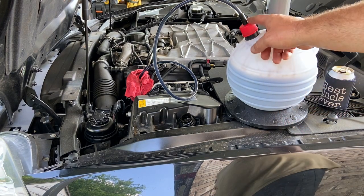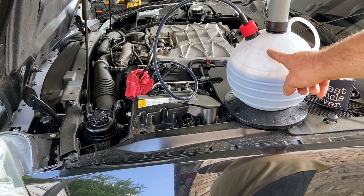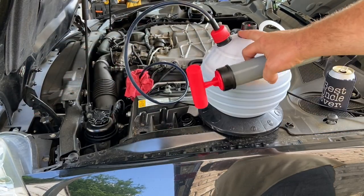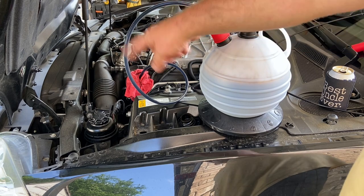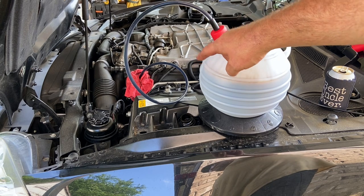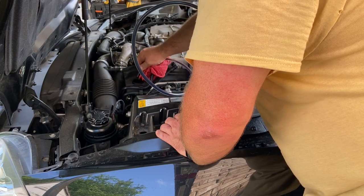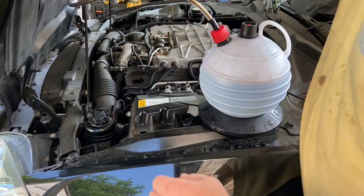All right, we're getting up to about five quarts. I've quit pumping — I'm gonna wait for this thing to equalize a bit. The nice thing about these little guys is that once you're pumping, you can actually pop the lever off and the seal up here will still hold a vacuum. So take that off. Now if you break the seal up here, all this is going to drain back down into the engine — which is fine — but it also increases the likelihood of making a mess under the hood. So what I'd like to do is disconnect it here, pull the hose with me so it sucks most of it up into the pan.